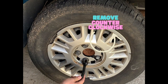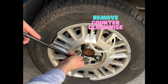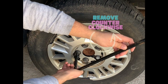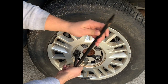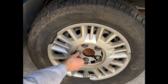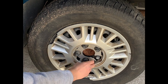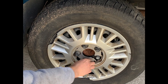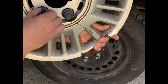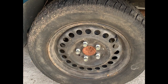We're going to have to remove these in order for the wheel to come off. These are really easy to remove because they are plastic. You just got to loosen them a little bit and then you can loosen them by hand. Something to note: these plastic lug nuts do not come off — they kind of spin in place. So you're going to want to loosen them as much as you can and then the hubcap will come right off. On other hubcaps they're kind of pressed in, so you're going to just have to pry it out if it doesn't come off that easy.